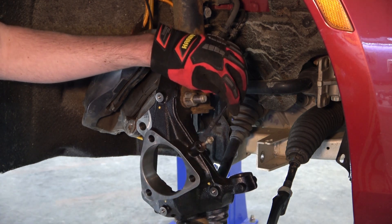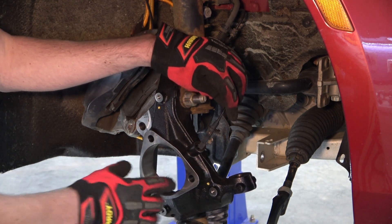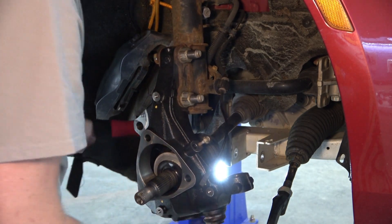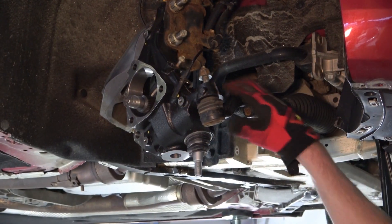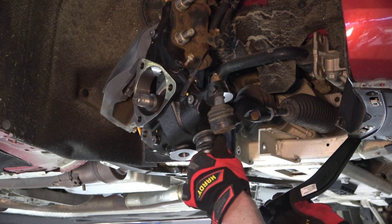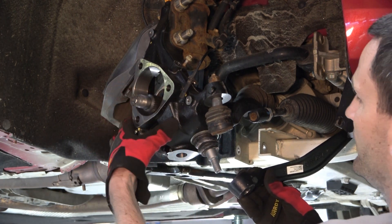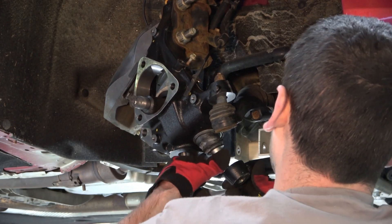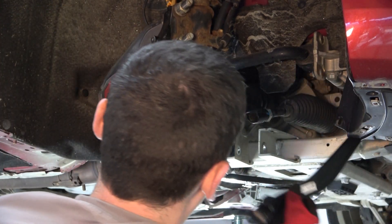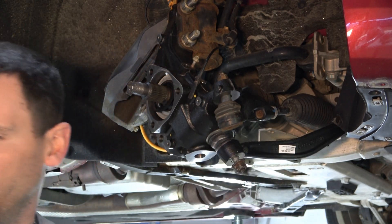Quick tip: don't get too excited and try to slide your ABS sensor in before we've assembled the bearing, because it protrudes into this cavity — you've got to have that bearing in there first or you will damage it. We can work the axle back in and let it all hang loose for the moment. Another tip when assembling multiple things at the same time: leave things obviously not fully torqued so it's clear you haven't gone back and torqued them yet. If you're like me, stuff like that can sneak past you, so leave this stuff very loose until you're ready to crank it down.